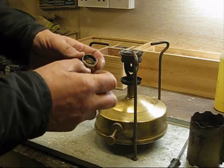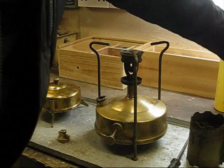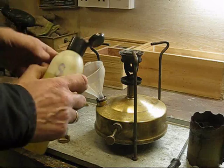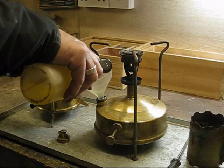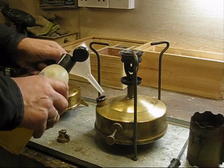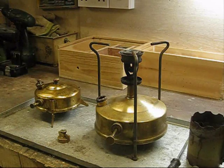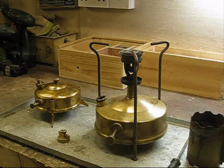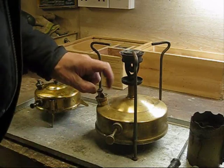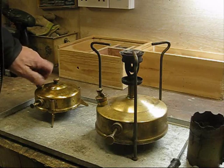In here this is a filler. What I like about this stove is the filler incorporates the air bleed valve at the same time. What we use in here is paraffin — and we only use paraffin, definitely never use petrol. You'll be arranging a funeral if you do, it's lethal. You don't fill this more than three-quarters full and that'll be ample. There's some in here so we'll just check — that's perfect. Always move these out of the way. Put that back on and nip it up. Make sure this is slack and loose, and same on this one — make sure the air screw is loose when you're going to light it.